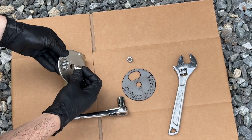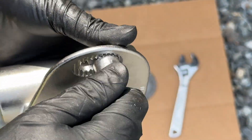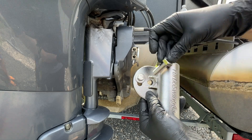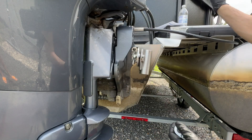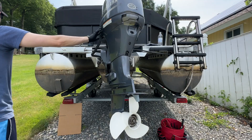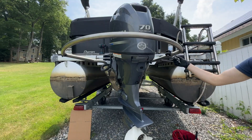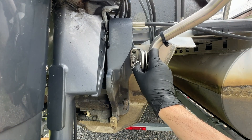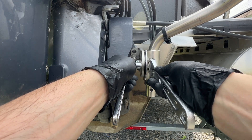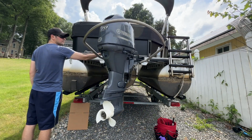Alright, the mounts are in place and now we can attach the brackets that hold the Turboswing bar. It has a little adjustment nub that you can use to control the angle of the bar. They recommend adjusting it to the setting that results in the bar being in the highest position. When I initially did this, I interpreted the instructions backwards and basically installed the bar at the lowest position. This bracket is pretty annoying to put on because there isn't much clearance between the motor and the bracket — you can't get a socket in there so you're basically left to tighten it with a wrench. I ended up taking the bracket off to adjust the little nub, but I realized you can totally adjust the nub while the bar is attached — all you need to do is support the bar, which I found easy to do with my shoulder. I finally got the bar in the most optimal place where nothing comes into contact when I put the motor up and down.